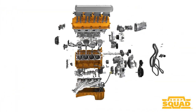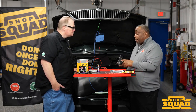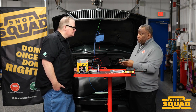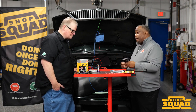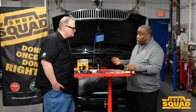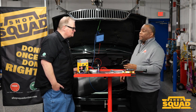Well, the original coil design on these hemi engines — where you have the dual spark plug output — is something shops love when cars like this come in, because we're talking about multiple spark plugs being replaced. When it comes to the corrosion buildup that occurs on the secondary output of these two terminals, there's been an upgrade so that corrosion would not exist. We're using different materials to make sure that when you troubleshoot the problem and replace the spark plugs and the coils, you know you're putting in a replacement option where you're not going to get that same type of corrosion.